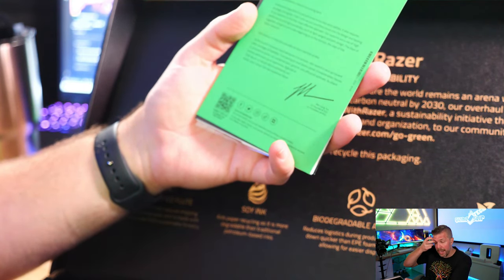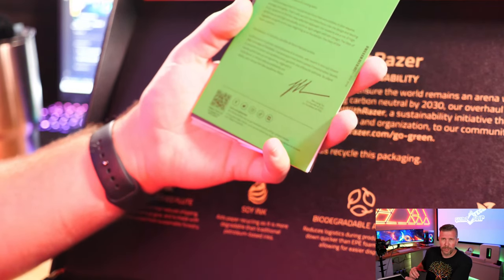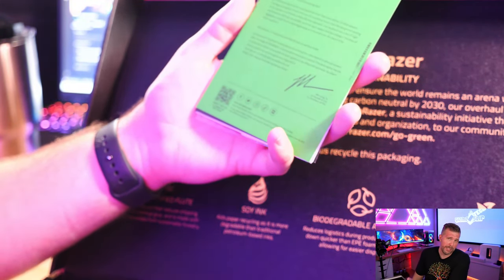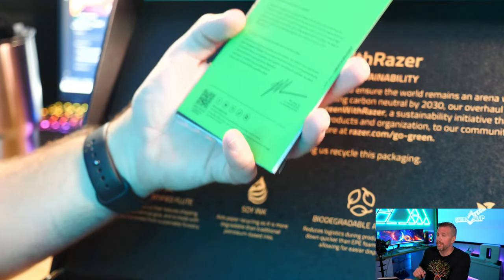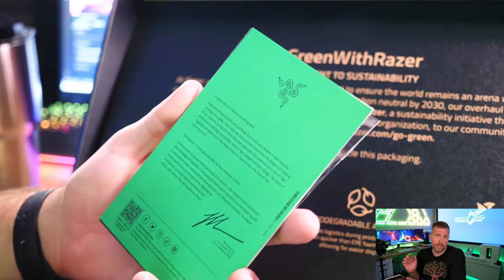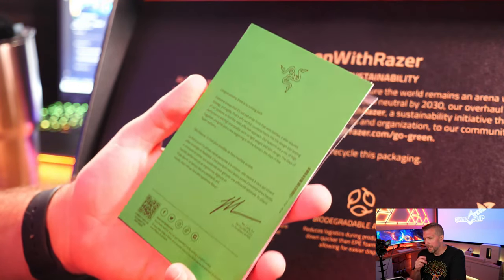But I have seen some people do... I saw a thing online where they modified the driver a little bit, disabling dynamic boost and then manually raising the power limit so it'd stay at 175. I'm curious to try that. We're not going to do that today, but it may be possible to get this thing to go 175 nonstop. The temperatures in it are phenomenal. I don't see why it couldn't go to 175 more often. All right.